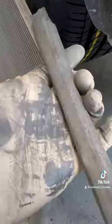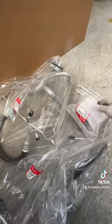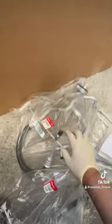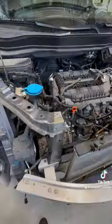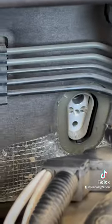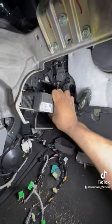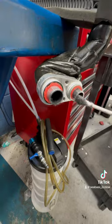It's a contaminated system. So, if you're one of the unlucky ones that has an AC system that's not working on a Honda Pilot, pray that it's not this, because it is a very expensive job. You pretty much have to replace everything in the AC system, down to the evaporator, which is actually easy to get on this year, but I heard on the later year ones, the dashboard does have to come out.